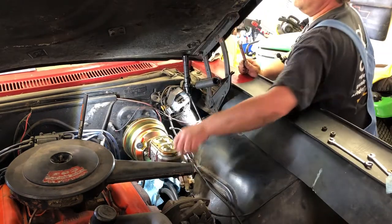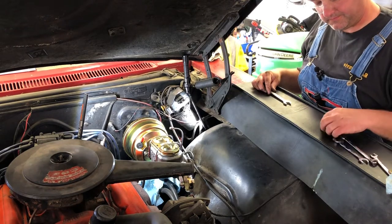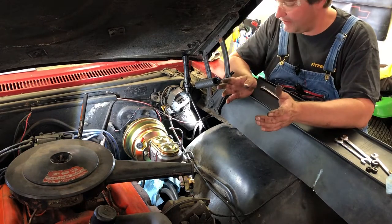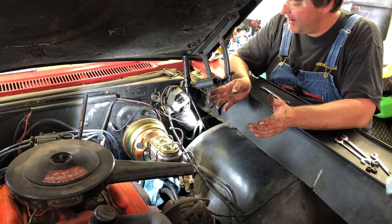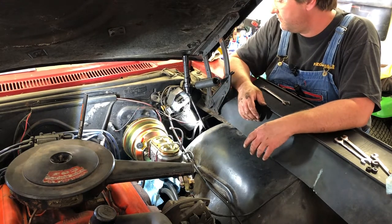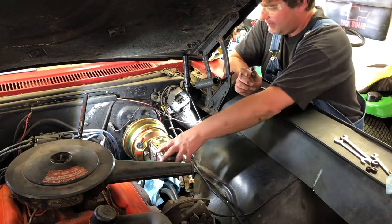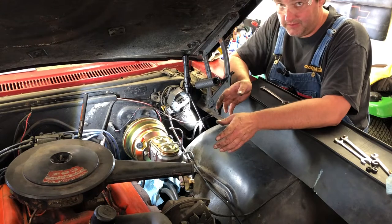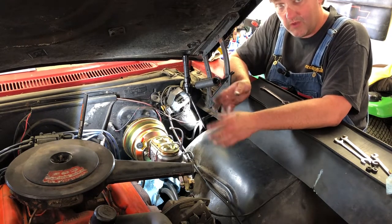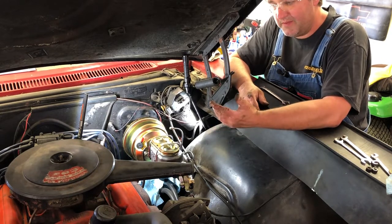Got the wrench. Well, just as I suspected, the studs on the car are longer and they bottom out against the studs for the booster. So now you get to take this all apart. And we either got to drive those studs out through the firewall or cut them off, make them shorter to match the other ones down low. That was not clearly portrayed to me in the instructions. So let me take this all back off. We'll cut the studs and put it all back on again.